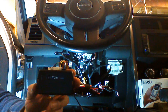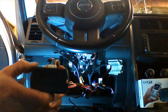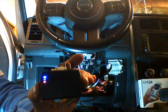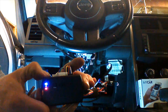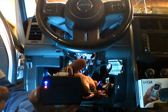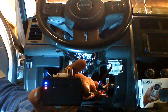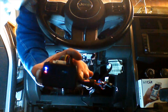We're going to pair the MyCar to our device. We're going to remove the 4-pin data plug, hold the program button down, and plug in the 4-pin data plug. We're going to release the button when we have the blue and the red lights both lit. Then press and hold the button down — the lights will go out — and release the button when the lights come back on. When we put the key in and turn it to the run position, the yellow light is going to come on in the center, and then the blue and red LED are going to blink. It only happens one time — this is acknowledgement that the Evo has accepted the MyCar.